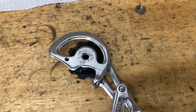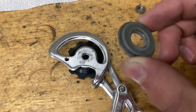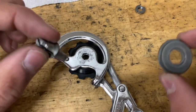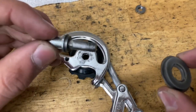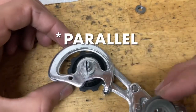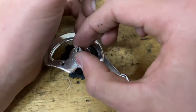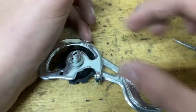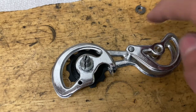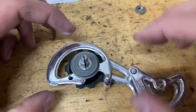Before you put in your bolt, there are two very important things to consider. First, your little plastic seal goes on here, so grease it up — SRAM butter is perfect for plastic seals and bushings. Make sure to grease up your seal on the inside edge and a little bit on the outside. Next is the bolt positioning — this is very important. There's a little hex key at the bottom, and you want to line up the little slot almost perpendicular to this part here. This is the normal setting for a Suntour derailleur, so when you put on the spring, you'll rotate the cage three-quarters of a turn to put the pin on. Or for a slightly looser setting, rotate it one click clockwise — then you'll only rotate about half a turn. I'm going to do the normal setting. Make sure to put on your little seal first, then make sure it spins nice and smooth.